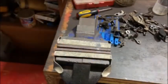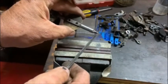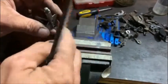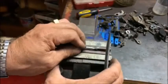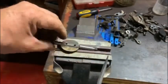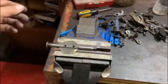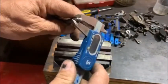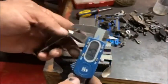Just to show you what I've done — I didn't record it but I want to show you. I had to put that flat on the shaft that I turned up on the lathe, so it takes that little link to open the second choke. I saw it was perfectly parallel with the butterfly, put it in my vise, held it by hand with a little square file, and simply filed it, measured it, filed it, measured it — turned it around and did the same on the other side, continuing until it was exactly the same size. That one measures 5.29, and then I fitted the little fitting.